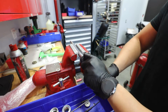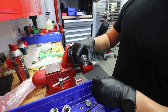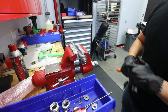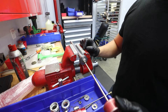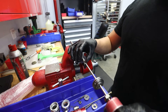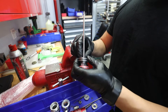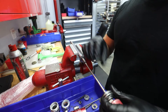I'll pop the 13mm off. I like to keep a bin underneath here just in case I drop anything. Now let's crank this down because this is usually on here pretty tight. I'll pop that off and grab just some kind of rod so that I don't lose track of where these shims go. And this is the whole shim stack. I'm going to put the front shims back on while removing one — the top shims are called spacers, they're just there to take up the slack. I'll try it out with that.